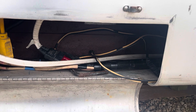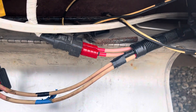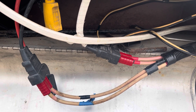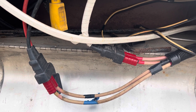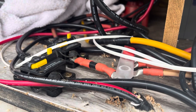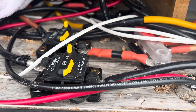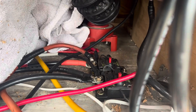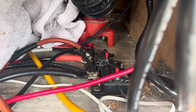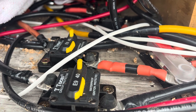This is something of a jumble, but it's really not too bad. Here's where they end — you can see the Anderson connectors; I like red so I use red ones, there are many colors. They're on number six cables. This is where they end up, ready to go up to the battery compartment. They are on 40-amp switches — there are two of them here, and I've doubled this, then go through another two over here. The ones over there are for the panels that are on the trailer. They're separate — two systems — but I can combine the systems for the trailer by using my new system.